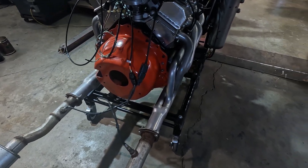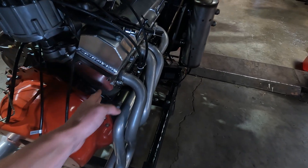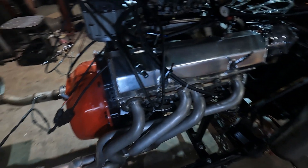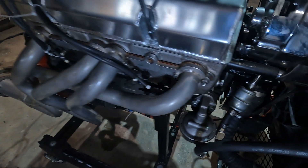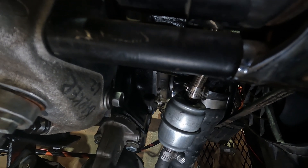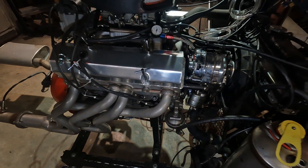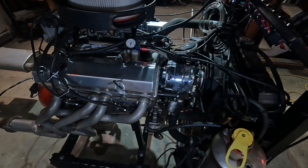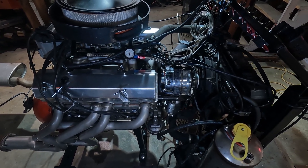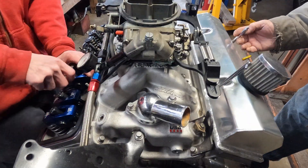When I got this, I was originally looking for a set of heads for my car and I came across these Brodix IK200s — I really wanted the heads. However, when I got the heads, I found out this was a Tony Barker combo. These are IK200s with the Tony Barker setup 383, and if you look online you can actually find a dyno sheet spec'd with this. This has an XFI 292 cam, Comp's cam with 1.6 roller rocker lifters.